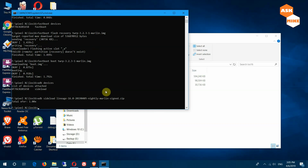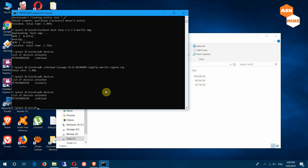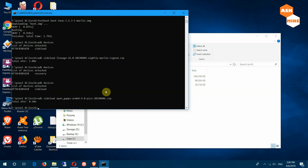So once you have finished the sideload, do 'adb devices' again to check whether you are still connected. You are now in recovery, so you will need to go back to your phone to start the sideload again so you can sideload your GApps. Do 'adb sideload' again and start the ADB sideload feature. Somehow or rather we have a problem with the GMS version — let me check that out and continue on with the process.